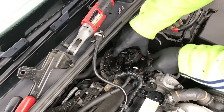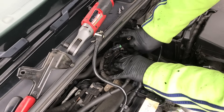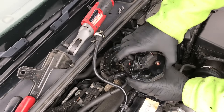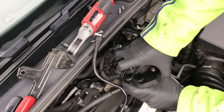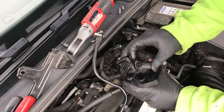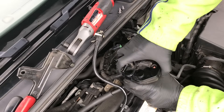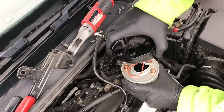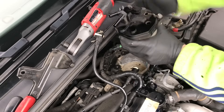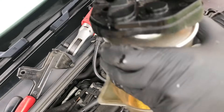Now we've just got to separate the top of this housing. I made a mistake here because I should have put the jug underneath before releasing it. The housing is tight on top until you twist the little centre plug — turn that centre plug and off it comes. As soon as you pull it off, diesel starts coming out the bleed hole at the bottom, so grab your jug and drain that down.